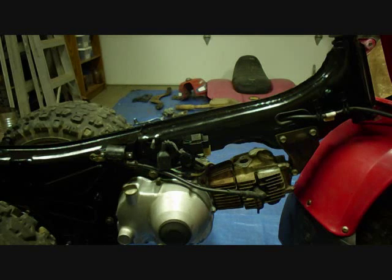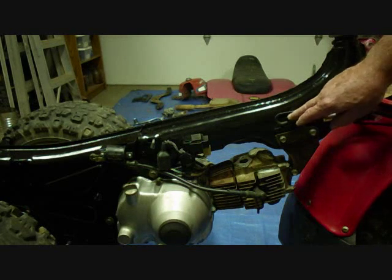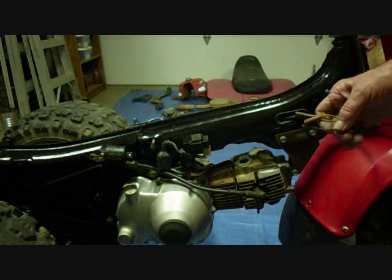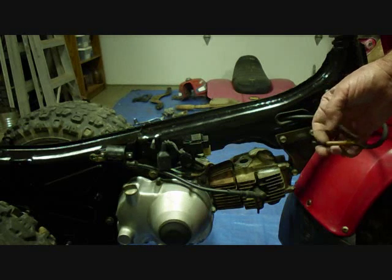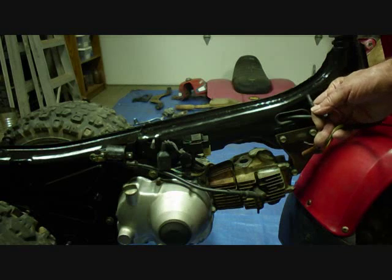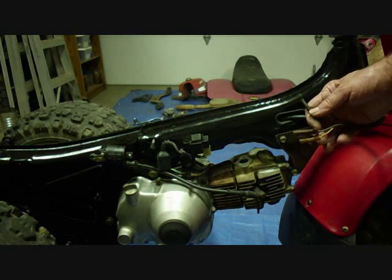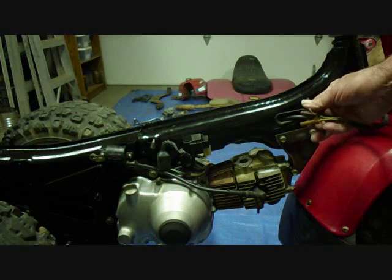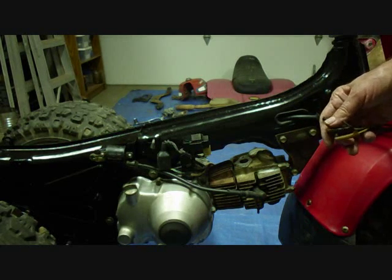We have all the electrical hooked up now for the engine to run, but we don't have any way to turn it off yet. That's done by the wire that comes out of the side of the frame — it'll go under the headlight housing. The way we stop the engine is to take this black wire and ground it. There's a green wire in here that's ground, so you can connect those two wires together, or ground this to the frame. Or you could use a switch.